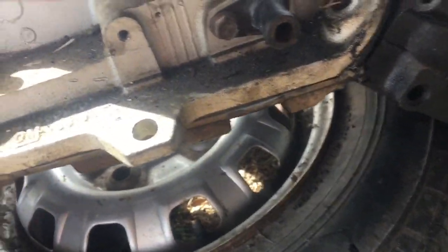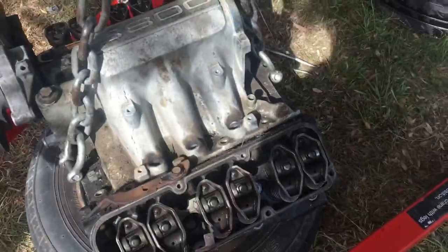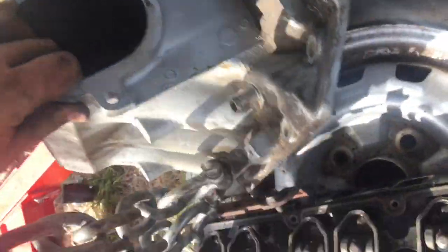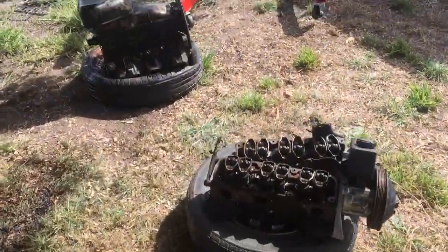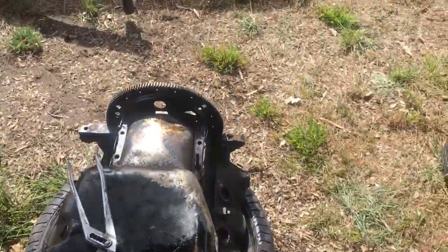I'll throw a chain around here or something - I just want to get it cracked up off the top of the block bit because it is still sealed on there with RTV or whatever's on it. Hopefully it pulls up - there we go. And that, people, is how you pull your head and intake apart. Works every time, but you also break your seal so maybe don't do it. I was thinking it actually had an auto trans on the back of it because of the torque converter. He had two red VR utes - one was a 5-speed manual and the other one was a 4-speed auto. I got the heads and stuff off and the rest of the bolts are in there, so now I'm just cleaning up. Thanks for watching guys, see you in the next one.